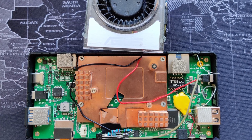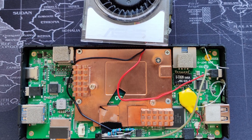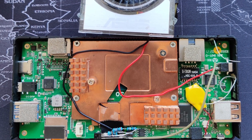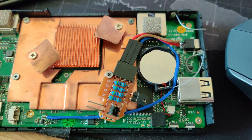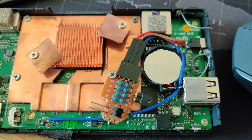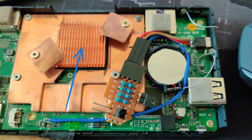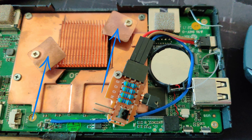I tried to fix the issue by replacing the internal fan with a larger external fan. I also tried to increase the heat capacity by adding a few copper heatsinks, but I couldn't achieve the results I was looking for. So I started to cut holes in the copper plate above the CPU, remove the fins on the back, and cut an opening on the top side of the case. The CPU is now directly cooled by this copper heatsink, which is pressed on the CPU die and held in place by these two copper pieces.